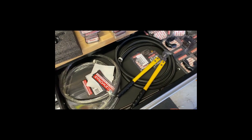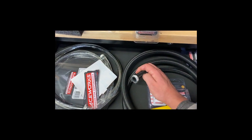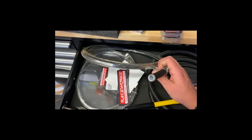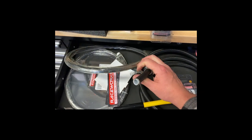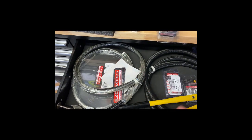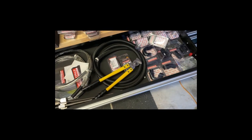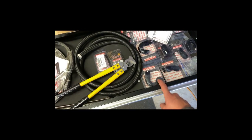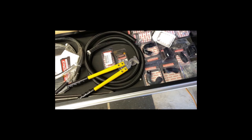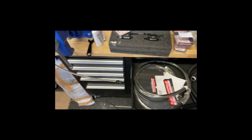What you want to use to cut your hose is a set of these — you can do it with an angle grinder and a thin cutoff wheel, but you end up with bits of braid inside the hose. Here's 100 series, which is just a rubber hose with a steel braid — you can see how thick that is. An equivalent AN-10 200 series hose is this thick, so the Teflon core is super space-efficient, which matters when routing in tight spots. These fittings get very expensive — if you can buy them off the internet they tend to be a bit cheaper, or find a good local supplier.